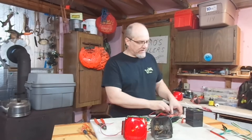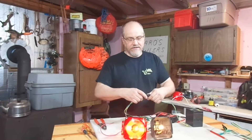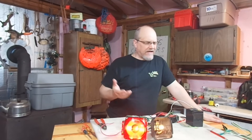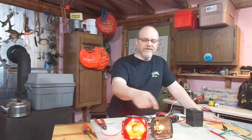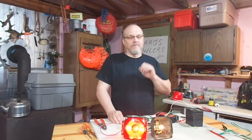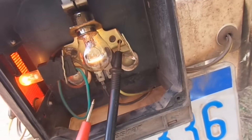Another example: if we plug this back in and the lights weren't working, we might want to check whether we have the voltage at the fixture itself. That would be another example of where knowing how to measure DC volts would help us troubleshoot our trailer lights. We'll get into that more in depth in videos further along in this series, but for this one we're just getting the basics of how to use this meter.